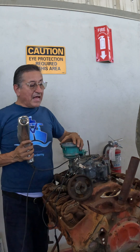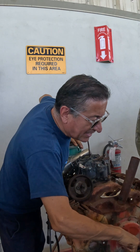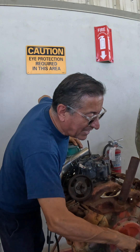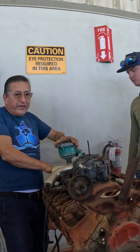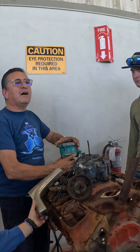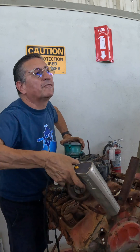Now you retard a little, point it here, and now the mark is here at 10, at 8, at 16 — here. In that moment, you fix the distributor to avoid the distributor moving. And once again, you point it and you see it's 16 degrees before.